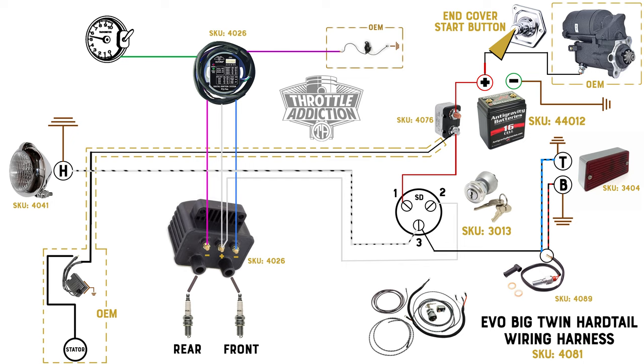The first thing we got here is our 30 amp circuit breaker. We are going to run a power wire from our 30 amp circuit breaker to our battery — that wire is going to be our red loose wire. Second wire, we are going to run from our 30 amp circuit breaker — this is going to be our power out down to the battery terminal on our ignition switch, and this is going to be the red wire in our main harness. Off of the ignition terminal of our ignition switch, the white wire is going to connect to our ignition terminal and then run to the center post on our coil, which is our positive. Any time our ignition switch is in the ignition or run position, that's powering up our coil.